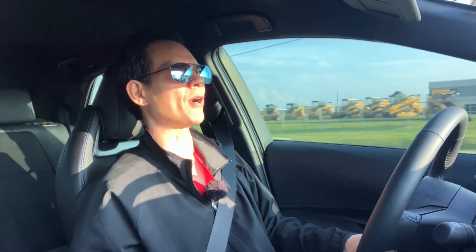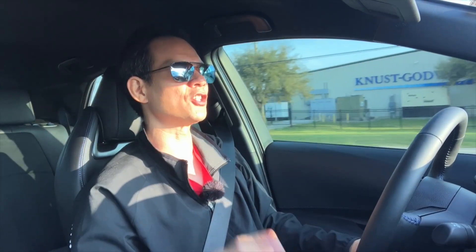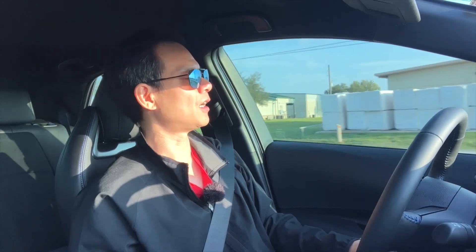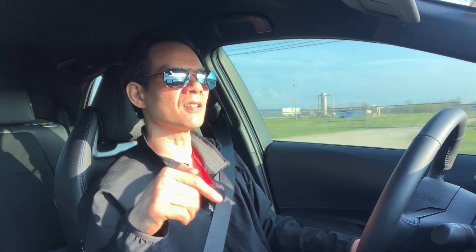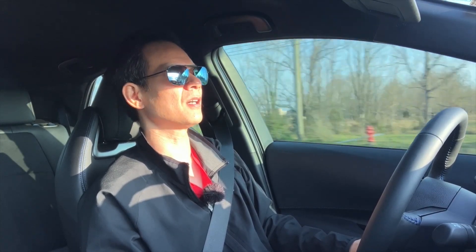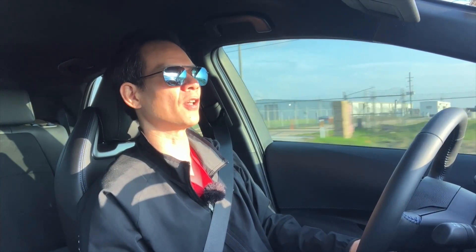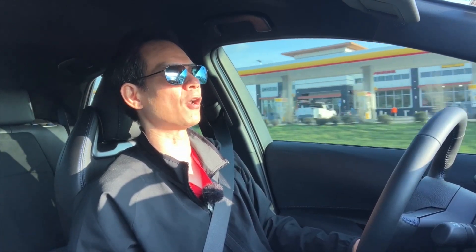I think I'll do a little bed-in right now — just a very light one. I go 70 miles per hour and then brake lightly all the way down to 20. Of course, make sure no one's behind me when I do that and make sure I don't come to a complete stop. My GS350 — I actually did put a pad imprint into the Brembo rotors by accident. It did eventually disappear luckily, just because I drove the car and did the bedding again. This one is a little more difficult. Can you guys hear the exhaust? It's pretty nice — it's got a low tone to it. On the highway there is a drone — you can hear it, sounds like a propeller airplane.